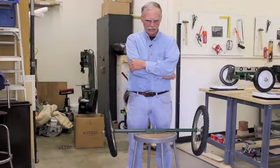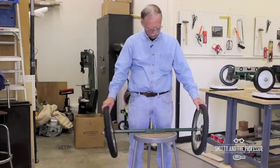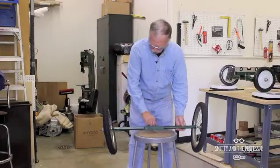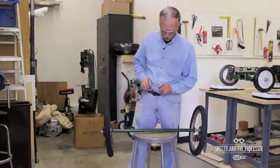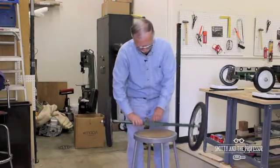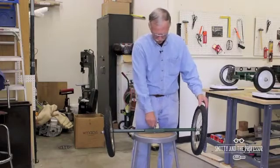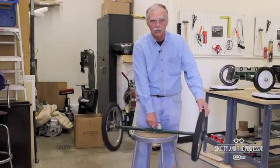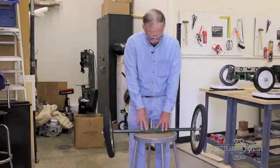Robert Smith here, and I want to use my little two-wheel demonstrator to explain positive and negative camber and toe on a vehicle — the basic settings of the front suspension. I have an axle with two small bicycle wheels on spindles, angled to allow demonstration. In the center I have a bolt, and back in the early days of wagons you had a solid beam axle with wheels on spindles, and the axle pivoted around a main pin — which became known as the kingpin. You'll hear that term in suspension and geometry technology over and over.